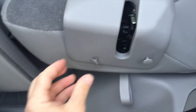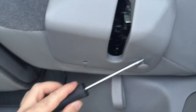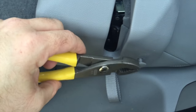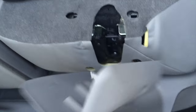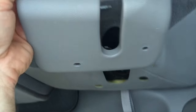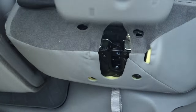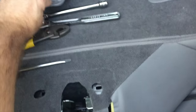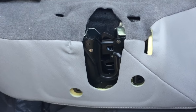To take this apart, you'll first need to work out these little rivets, which are a bit challenging to get off. I took a screwdriver and went up behind it, then used sharp-nose pliers to pull it back. Once I got that out, the cover lifted straight up. Keep in mind there are little studs here — pull it up toward the top of the car, not back toward you. Then the part will be visible.